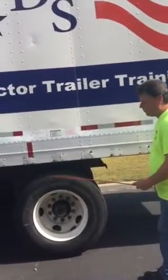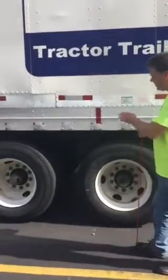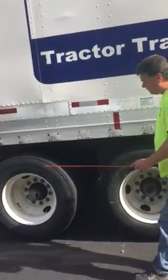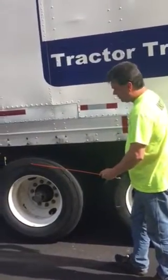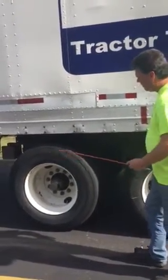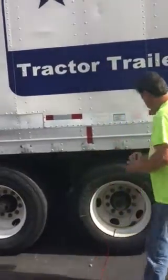Now I'm going to move into the tires for the third and final time, starting the same way as before. My space in between my tires — they're properly spaced, they're not touching, and they're free of any objects or debris. These tires are filled to 100 psi, which I would check with a tire pressure gauge. There's no uneven tread wear. The sidewalls are not cut, cracked, dry rot, or bulging. These tires can have no less than 2/32nds of an inch tread depth, and these tires can be mismatched, retread, and recapped.